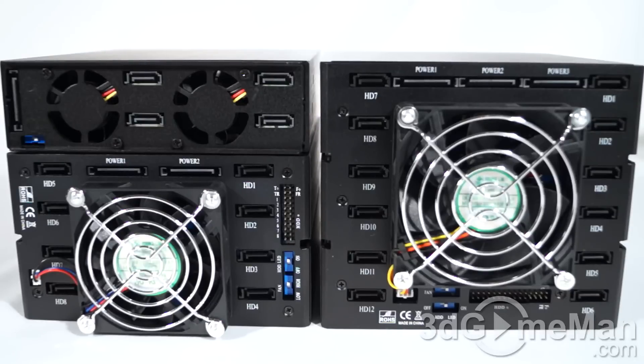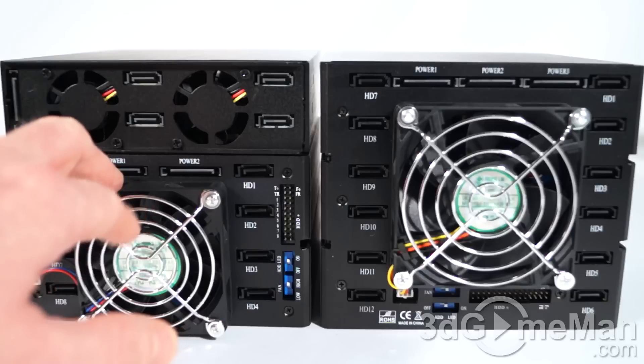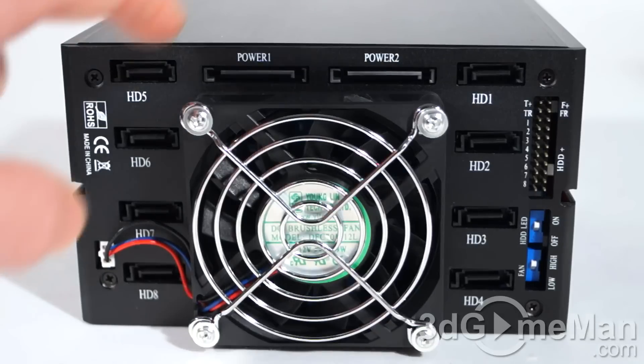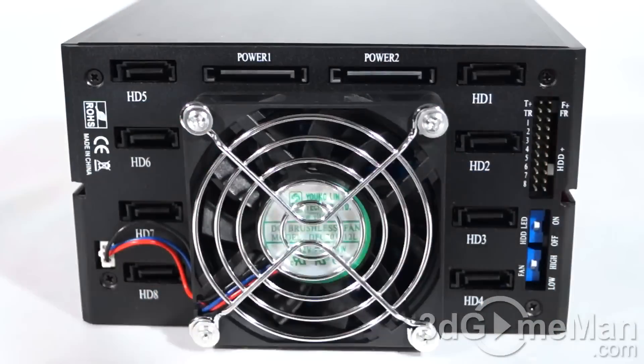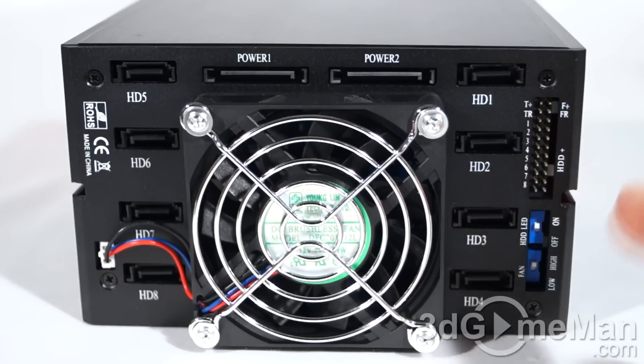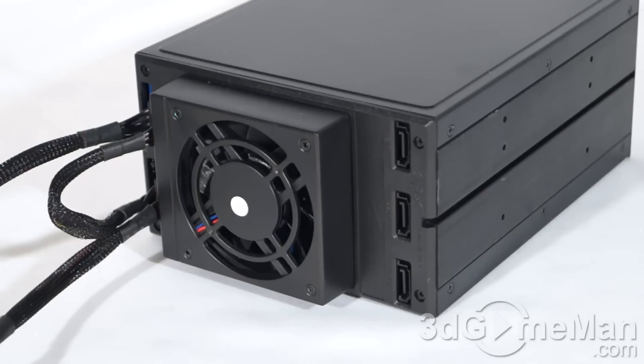The back of the M2500 racks is pretty much the same as the M3500 racks, except they have varying fan sizes. The four-drive model has two 40 millimeter fans, the eight-drive model has a 70 millimeter fan, and the twelve-drive model has an 80 millimeter fan. You have standard serial ATA power connections, all the data connections, and jumpers for adjusting hard drive activity, fan, and temperature. There are two switches: one for fan speed — low at 2,400 RPM or high at 3,000 RPM — and one for turning the hard drive activity LED on or off.